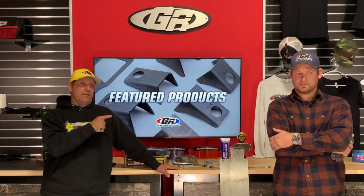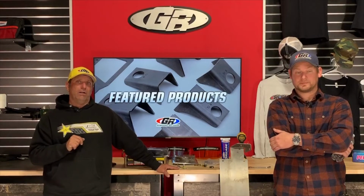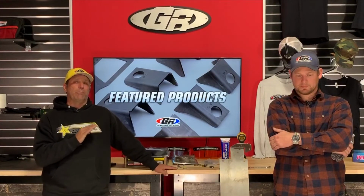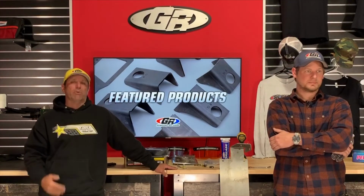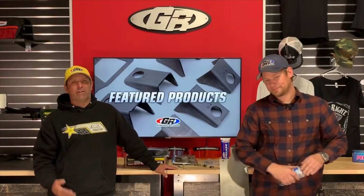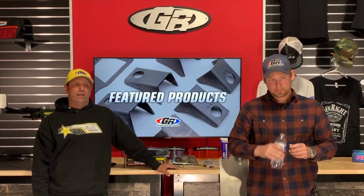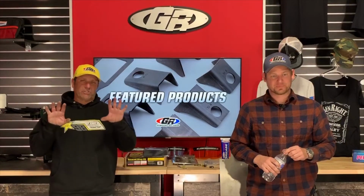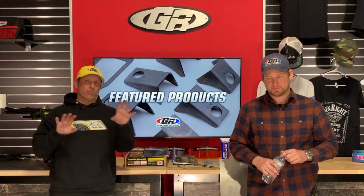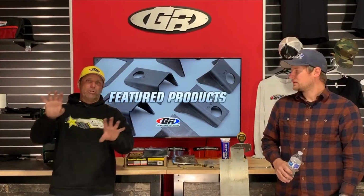Now, today, we just finished a dark green JK four-door with a Hemi. It's beautiful. The Hemi was put in by AEV. It was done before the Jeep came to us. And it just took a lot of extra time, guys. I think it was 30 extra hours. Part of the problem is that all of the components, all the accessories, your alternator, power steering, everything, are cast into the front of the motor. So you don't have the ability to move that stuff around.